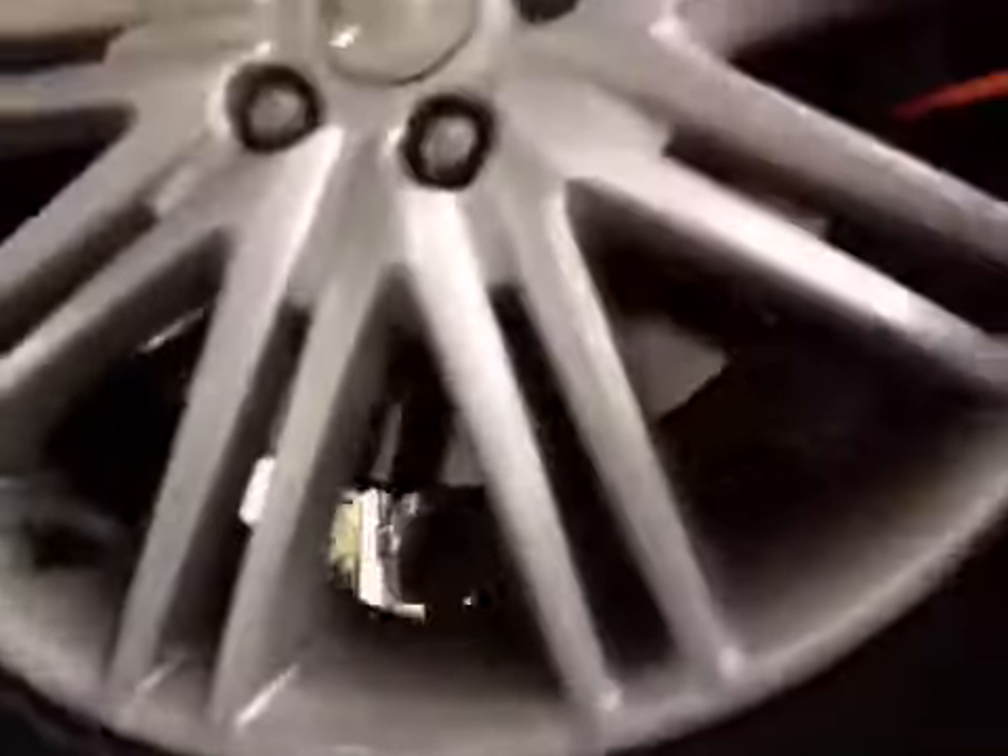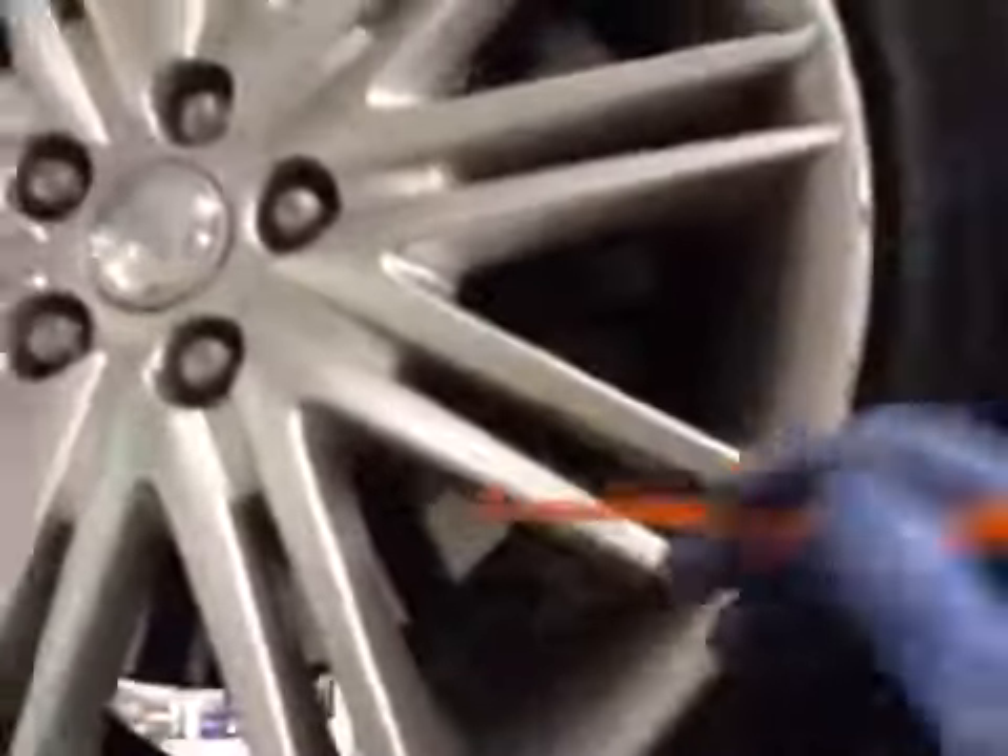Driver side rear tire — the tire is just about 5mm. No foreign objects inside the tire. All the rear suspension on the driver's side looks to be all okay. Rear disc has a slight lip, and your rear brake pads are rocking on about 5mm. So the pads are in amber, disc in amber, and tyre is in amber on the health check.